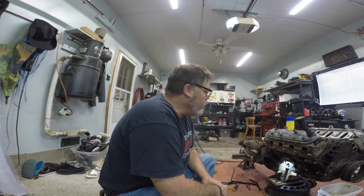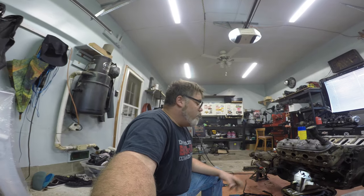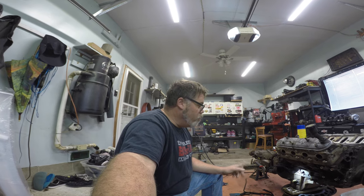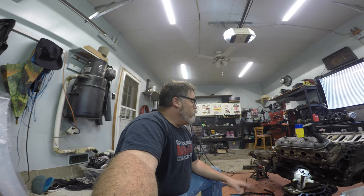So we're getting somewhere today. We'll put some good head gaskets in her and get maybe an ARP stud kit for it. We should separate it today from the transmission so I can get this motor on the stand so we can get the dipstick tube out of the bottom of the oil pan. I just want to do a little short video of what I did and how to get studs out - and remove the dipstick tube and then take the water pump off. It's only about 23 minutes long. It's Sunday, one o'clock, it's raining out. Pretty happy about my progress this weekend. Got a painter - leave any comments down below what color I should paint the block. It's going in the van.